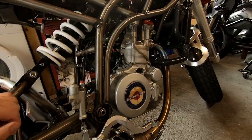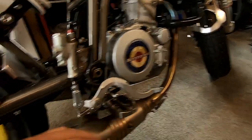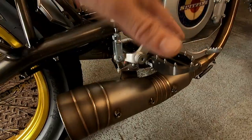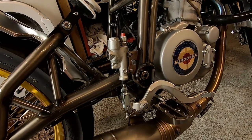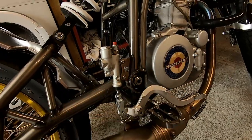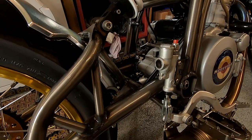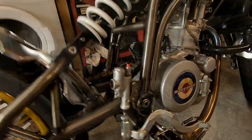The other adjustment I've done: I've altered the brake. This brake was about level but it was a little bit too high for me. It's a case of undo the lock nut here, adjust this, and adjust the stop nuts at the bottom to wherever it's comfortable for yourself — and that's so much better. The other side — the gear change — needs adjusting. It needs dropping down; I just keep missing gears because I usually have my feet a little bit far back and I just can't get it enough. So it just needs to come down a few degrees. But to get it off I've got to take either the chain off or the front sprocket — I think the front sprocket is going to be easy, because all it needs to do is just come out, just take it off the splines, and then we can sort that out.